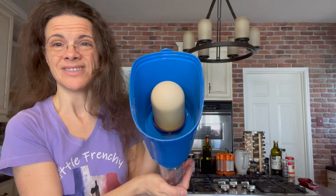These are not cheap filters, so let's see. Ideally, after cleaning — or even after putting in any filter, even a new one — you want to do a dye test to make sure it works. This one here is also yellowish, the one we use in the fridge, and I don't like it. So: soap water for the plastic and scrubbing for the filter. You can see it's kind of yellowish, especially at the bottom where the water stagnates, and that's the most-used part of the filter anyway. Let's get it going.